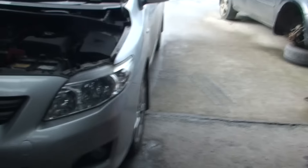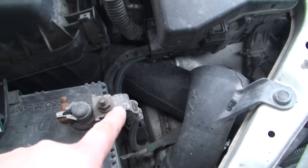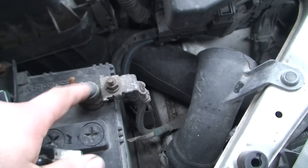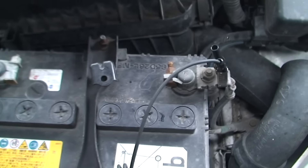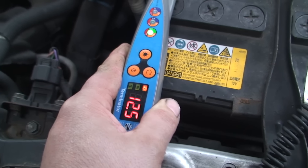As you can see, I've just got it ticking over — no lights, nothing on at the minute. What I'm going to do is put my battery tester on it. I want to test the alternator first, so I'm putting it on the actual leads, not the stub of the battery. And as you can see, we're reading 12.4, 12.5 volts.